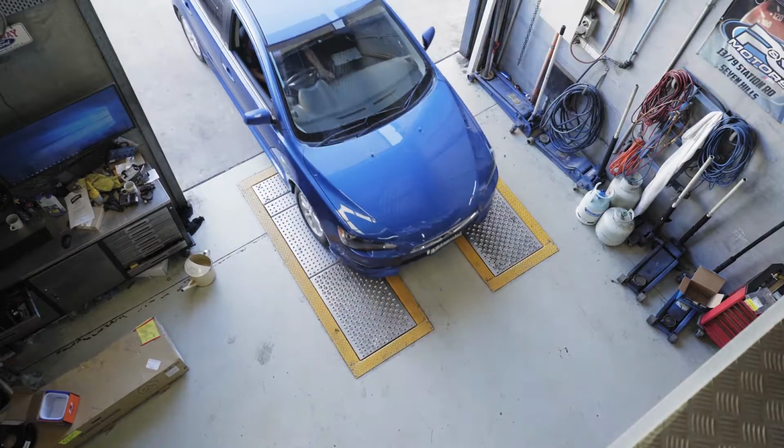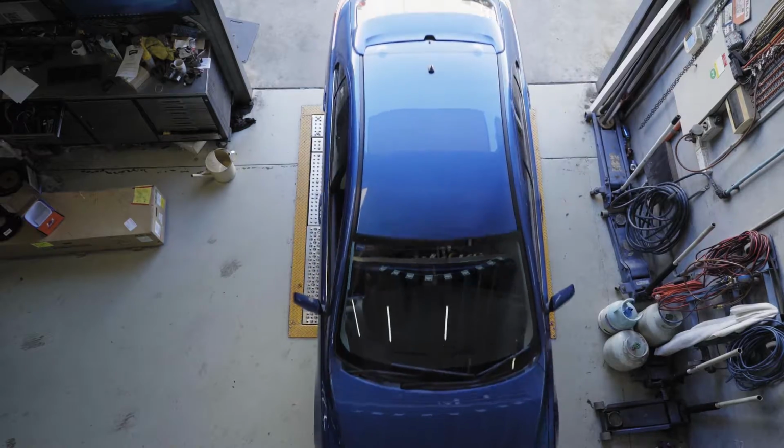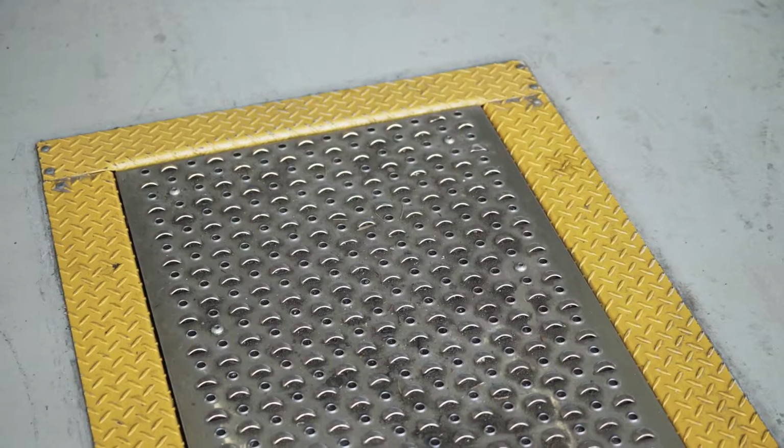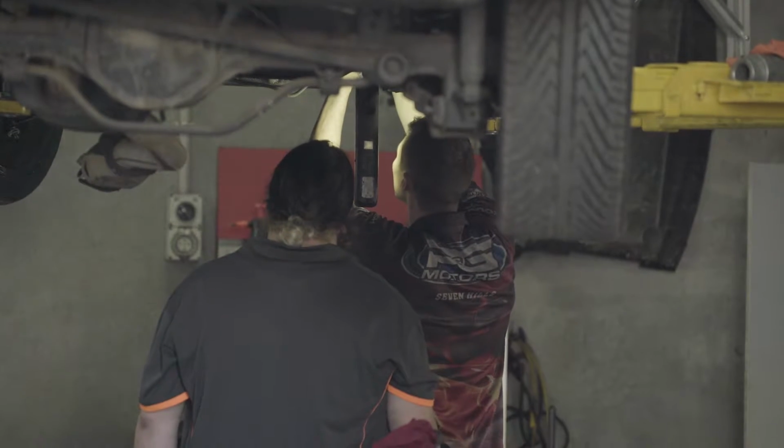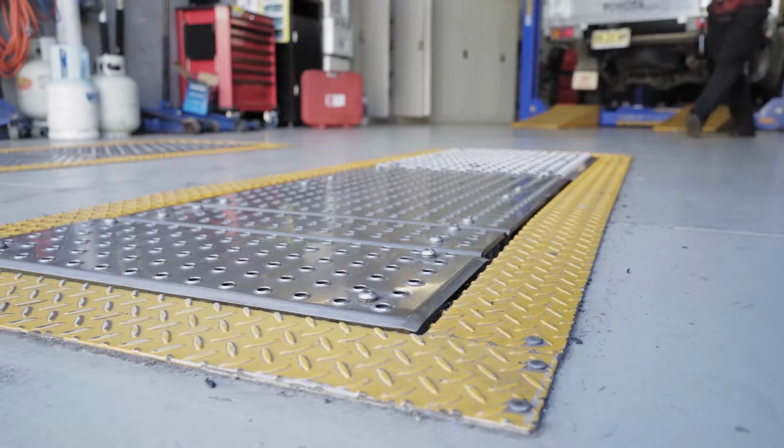When tradesmen have too much weight on the back of the vehicle, it gives us a clue of what their weight distribution is like on the rear axles, to know whether we need to upgrade their springs. How far are they over the GVM, or is the vehicle overloaded and that's why the brakes don't pass? The SafeTstop has a good feature of being able to tell weight per axle. Even though it's not a certified weighbridge, it still gives us the diagnostic aid to know what's going on with the car other than guessing.